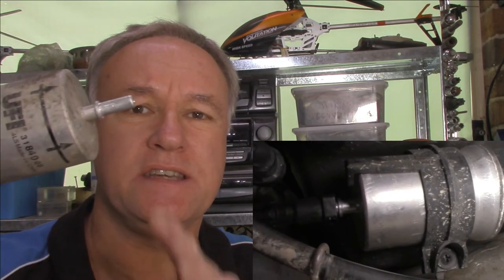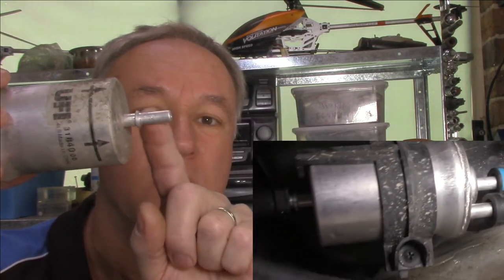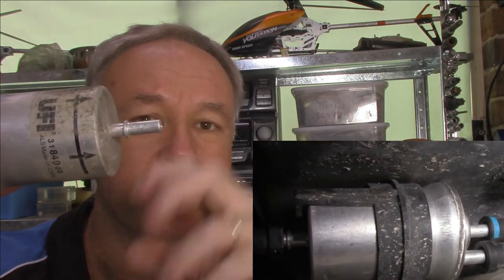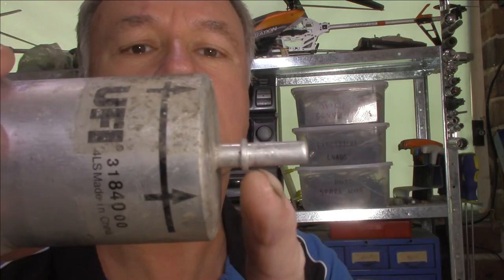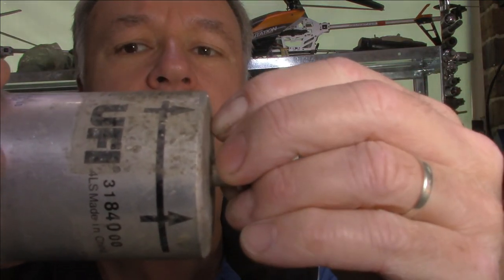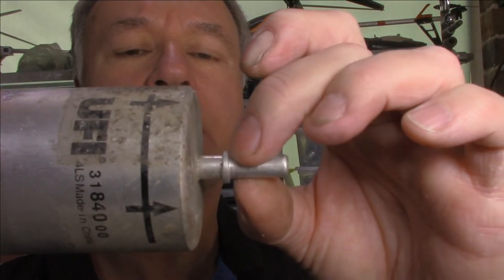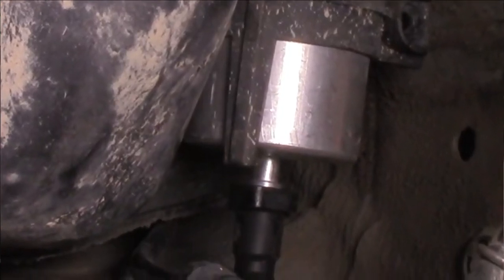If you have a really close look at the video, you can see that I didn't actually click in this particular section or this particular pipe onto the outlet hose. Now, you could see me struggling there, pushing it on, but I didn't actually click it into place. This little ridge here is where the connector goes on, and the clip goes on the opposite side of that. Now, if you look on the video, I haven't got it all the way on. Even though I struggled and pushed and I thought that I had, it did not click into place.